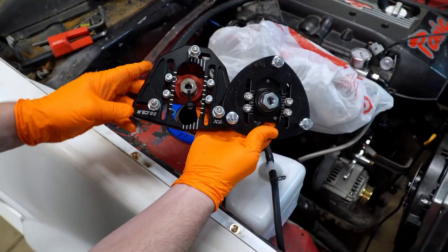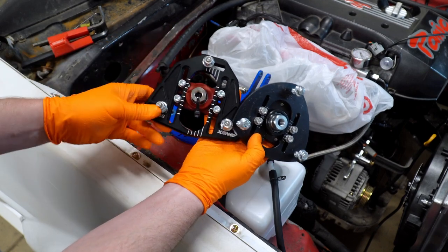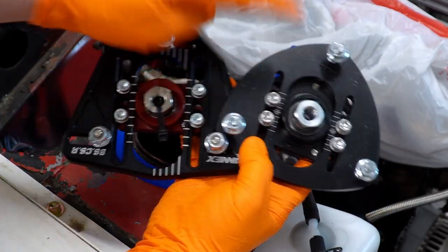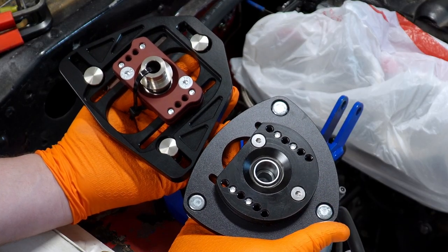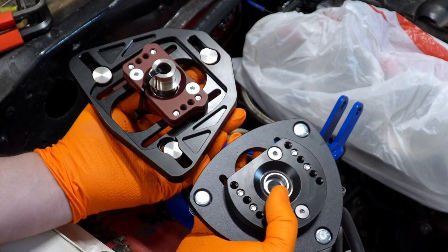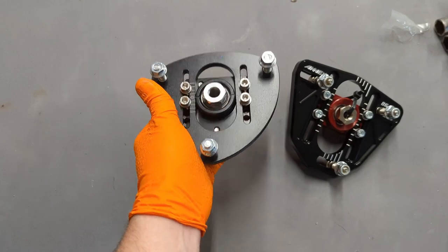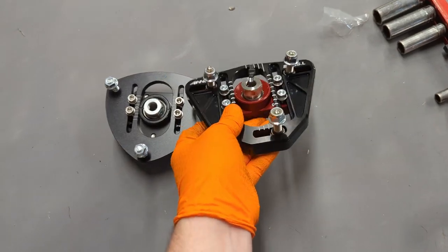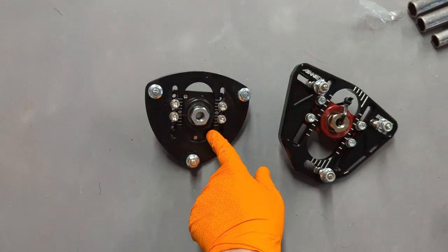This is the right side. Looking side-by-side, you can see the caster adjustment — the studs can slide. Also look at how much more camber adjustment there is on this top hat versus the old one — significantly more camber adjustment available. The bottom side looks pretty similar with just a few small differences due to the different mount design. One nifty thing is picking these up and feeling them side-by-side: the caster-camber plate is actually quite a bit lighter than the standard camber plate.